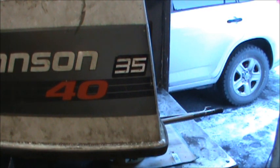And these motors can be problematic in the fact that in that fishery, you got to remember, Alaska summer days are long, very long. These guys will spend literally 15, 16 hours going up and down that river at idle. And we know what that does to a two-stroke motor. It carbons them up. I've had these Kenai River motors come in here so bad that I had to go out there at night and do a decarb on them. They were just that gunked up. Hopefully this one won't be that way, but we don't know. So that's what's a little bit unique about this motor.